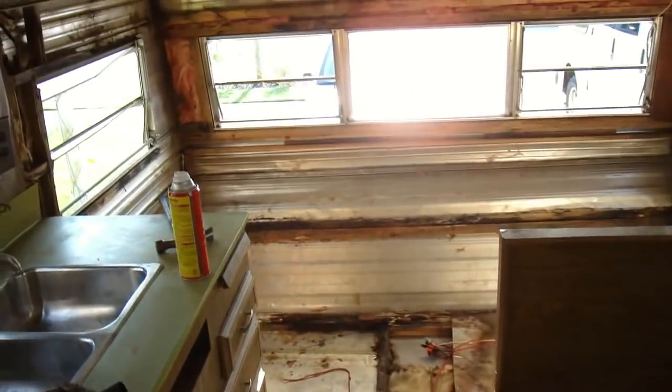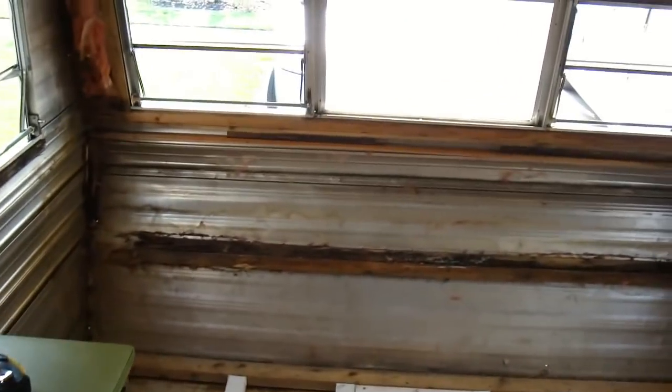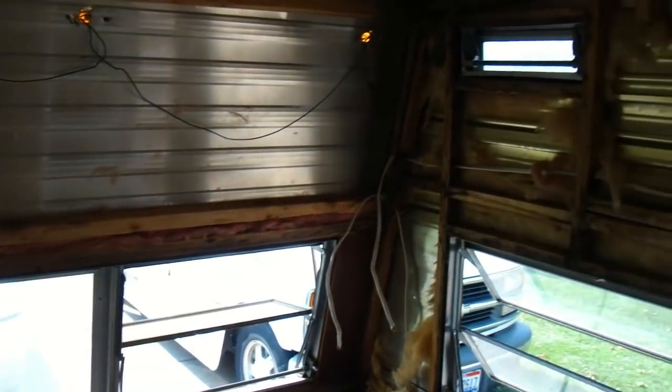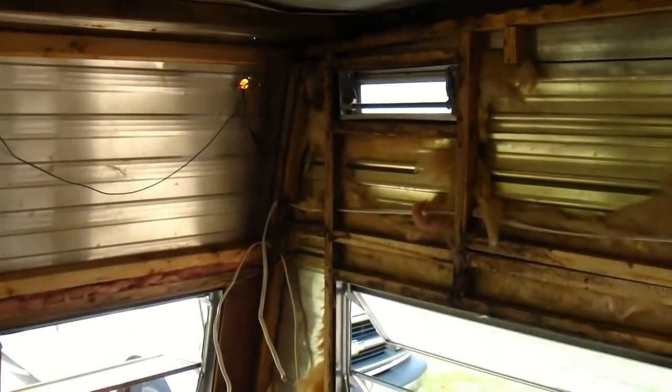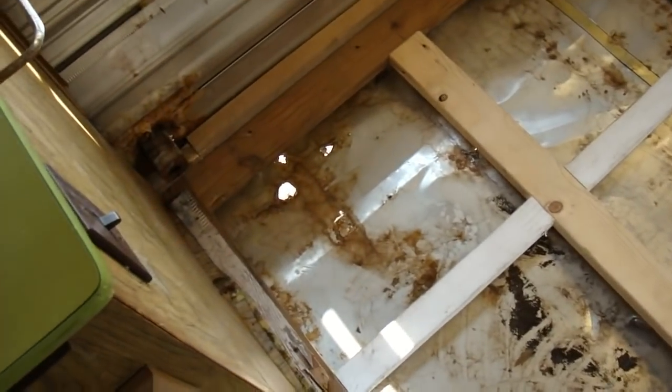Let's see what I got done in the last couple hours. I gutted everything because the water was coming in over here and got this whole side wet, so I cut it all out and put all new wood in. Billy Dee with the extreme trailer park trash makeover! I gutted this whole entire section — you can see the aluminum, that's the outside aluminum. All these things are two by twos, all framed in. I've rebuilt this whole subfloor here; it was all rotted away, so I ripped it all the way back out.